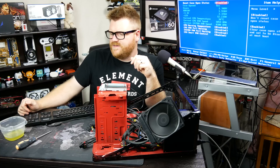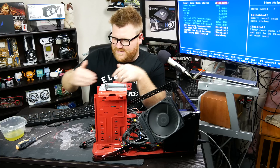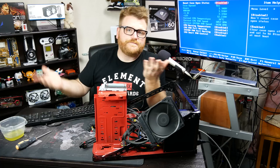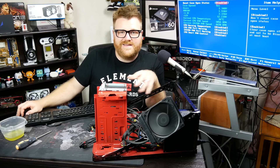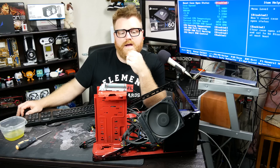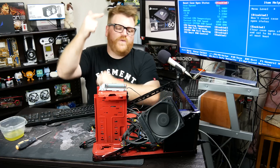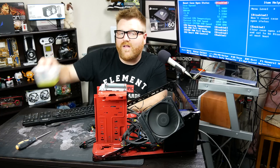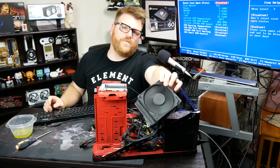It took me two or three hours to do this, and I was hoping this was going to be a quick video — my feet are wet, my stuff's all wet. But in the end, you can clean it out, put some Brasso on the copper block, and make it work again. These are meant to be dumped though — they have a five-year warranty, so register it and get one replaced as soon as it's not cooling right, especially with Corsair. Inside six months I knew something was up. You can fix your AIO if you really want to — it just requires a lot of elbow grease.